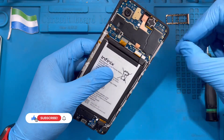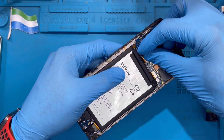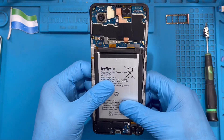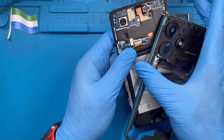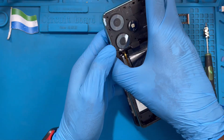Put the panel cover back over the LCD connector, making sure it sits straight and clips in on this side. Now put back the back frame. Before you close it, make sure you reconnect the fingerprint connector properly, then put the cover on.